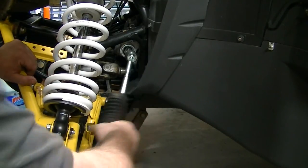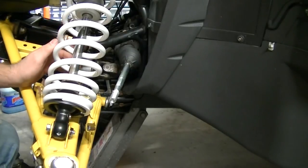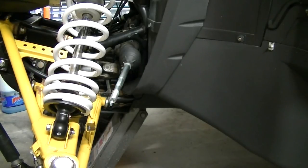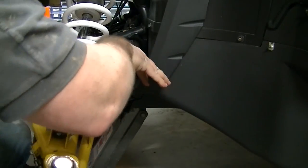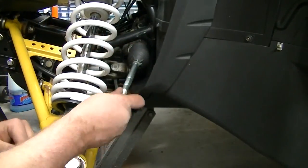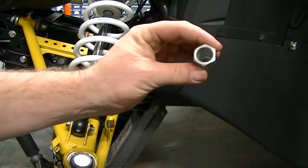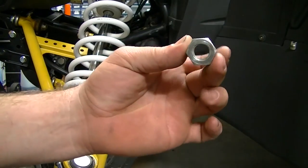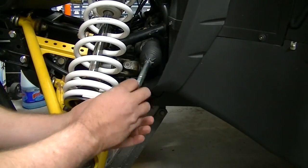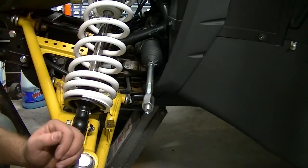Put the boot back on. I'm going to use a regular hose clamp there. I'll get the hose clamp put on and run the lock-down nut back on. I was running this tie rod nut back on and wasn't paying attention — it actually has threads on one end and no threads on the other. The part with no threads goes to the car side. You'll figure it out pretty quick if you've got it on backwards because it won't thread on all the way. Now I can go do my hose clamp.